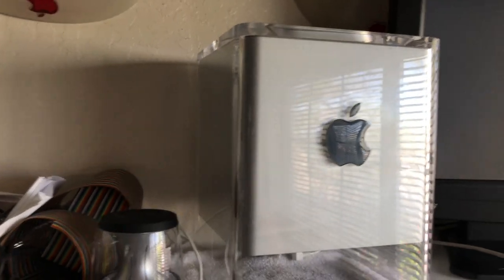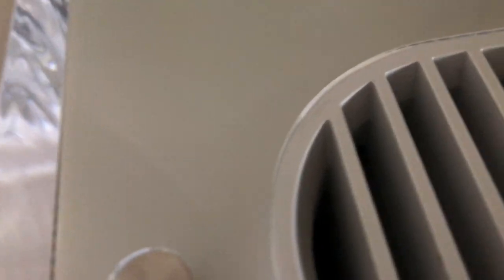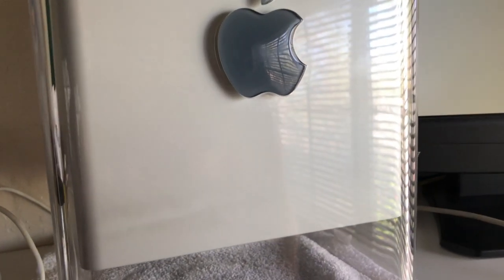Okay, guys, so I'm booting it up. This has been quite an experience here. It's all back together. You can hear it's really quiet. I got the phone really close to it, and it does. It's a 12 volt fan, but I run it at 5 volt instead, because it's much quieter. When it was at 12 volt, it sounded like a hairdryer. So it really pumps the air through it.